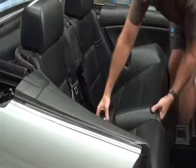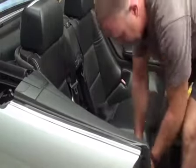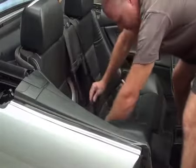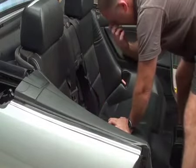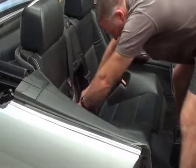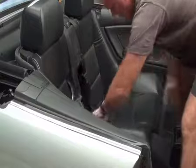Then all you need to do is put those 10mm nuts on there and just screw those down gently. Pretty simple. When you're pushing the front seat back in, you just need to thread the seatbelts into the correct spots. Push it rearward, and once it's in there, push it straight down — two clips and you're in business. And then we're just going to get that leather piece, which is the one that exposes the release and the Allen key for the convertible lock. Clip that down, and then all you need to do is put the seat back in place.